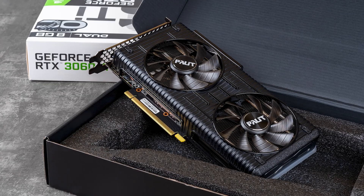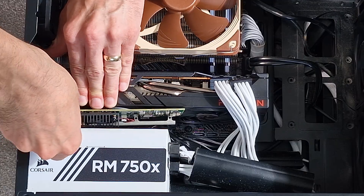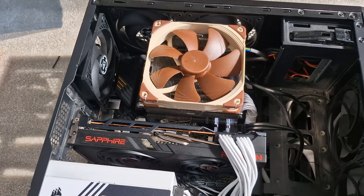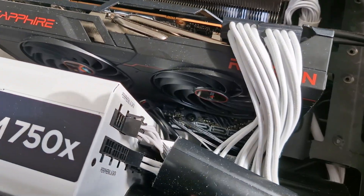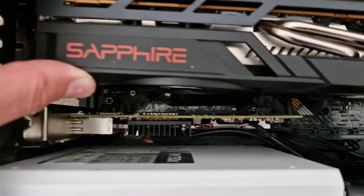This all comes down to the width of the GPU, something people discuss as the slot width. This screw method might work well for a 2.0 GPU, which usually comes to around 35 or 36mm — basically just under an inch and a half. While 2.0 means they mainly cover two PCIe slots, these GPUs are often thin enough that the screw method might just about work. However, my Sapphire RX 6700 XT is a 2.2 slot GPU, which is around 42 or 43mm wide, making it too wide for this method. You also have to be conscious of cooling — squeezing a second card right next to your GPU will likely reduce its cooling performance quite a lot.